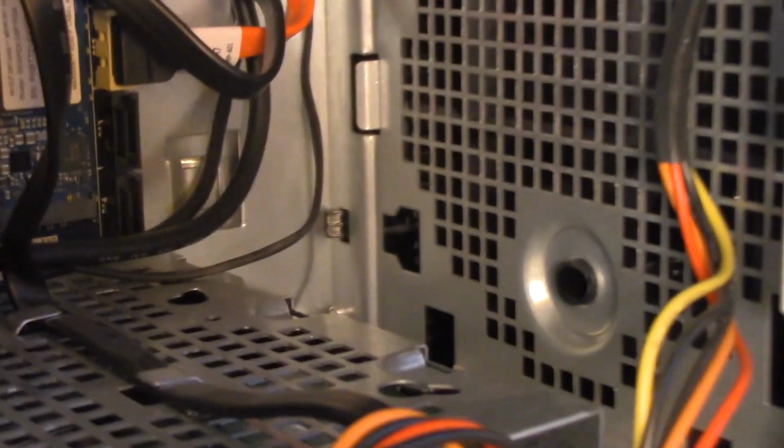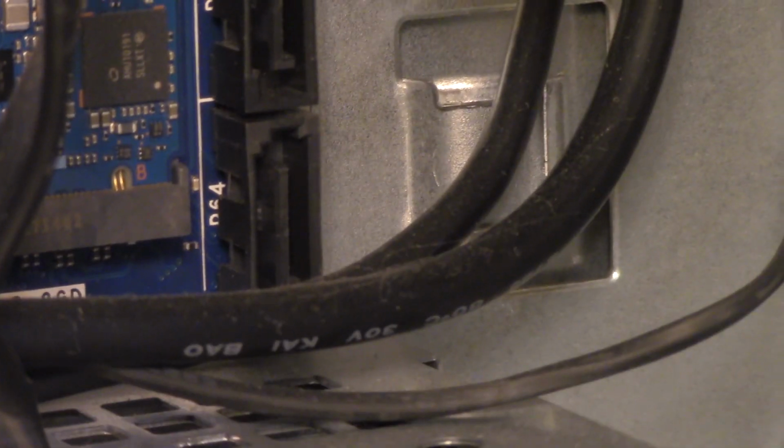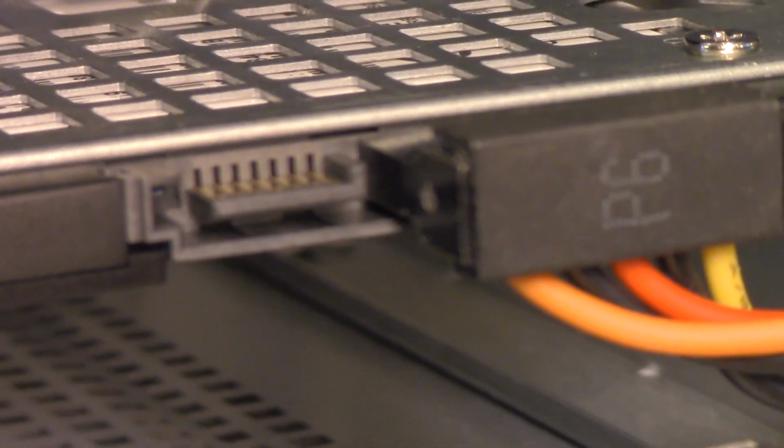So now the SATA cable is going to be plugged in to the motherboard, kind of right here. If you can see, there's two spare plugins right there. They have an L shape, and then you see a couple of others right above it that have actual cables connected. So that's where one end of the SATA cable is going to be connected. And then the other end is going to be connected directly to the new hard drive right there. You can see that also has a little L connecting feature. And there you go, my new blue cable is connected into that free plug right there.